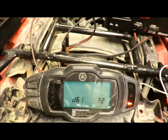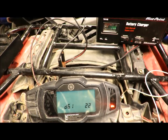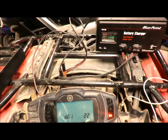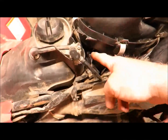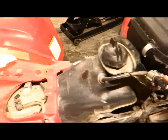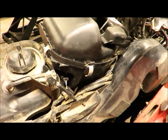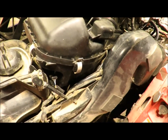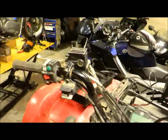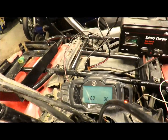After D60, the next most important mode is D61, which shows your history of codes. This machine has a code 22 in there — I have to look that one up. It can throw codes when you unplug something and then turn the key on; for instance, I had the airbox off and it sensed the airflow sensor was missing. Speaking of which, whenever you clean your air filter, be careful of that airflow sensor — don't contaminate it with oily stuff or touch it; it needs to be as clean as possible, otherwise you'll throw weird codes.